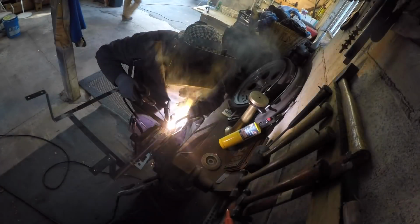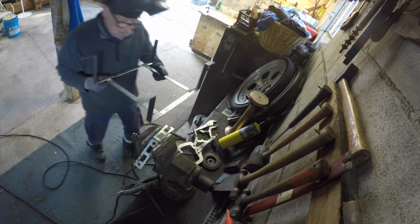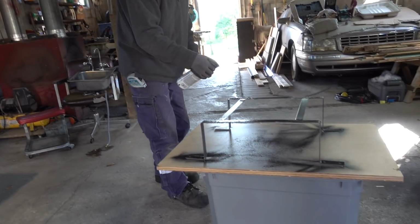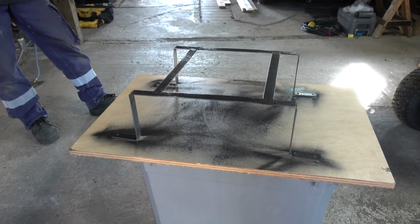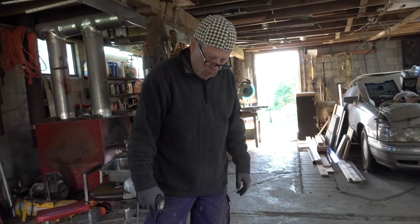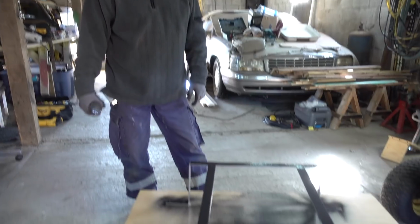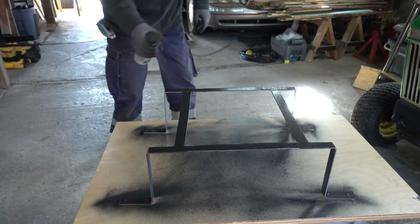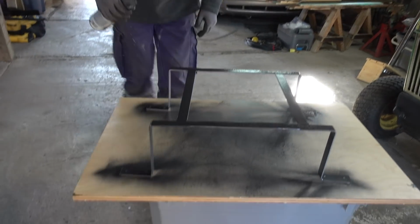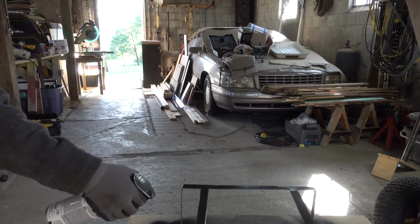Which was what, angle iron? No, it wasn't. It was all flat. Bent what I had to bend, drilled the hole, welded together. Explain what this is. This is for holding the gray water strap bracket. So we use 1/8 inch, 1 inch wide metal, which we bent, welded together, fit up to go to each frame rail. It's more than enough support. I'm covering it with a primer and paint mixture to make sure that the elements don't rot it away.